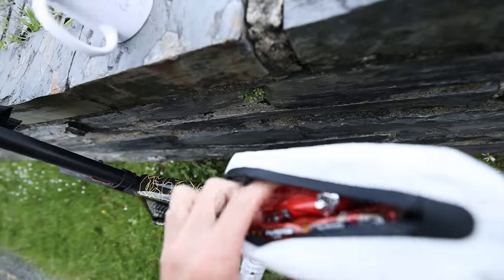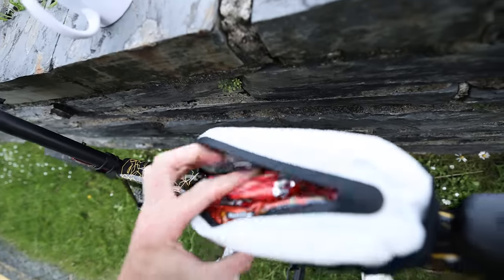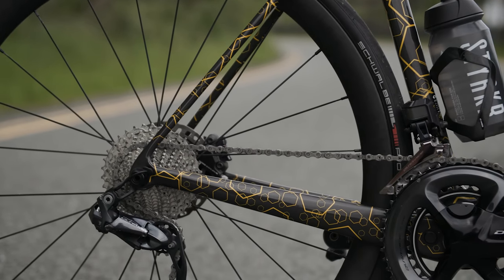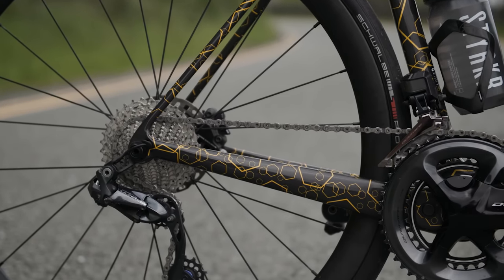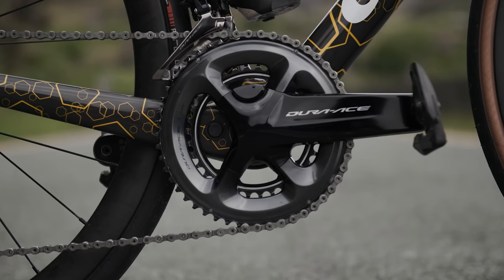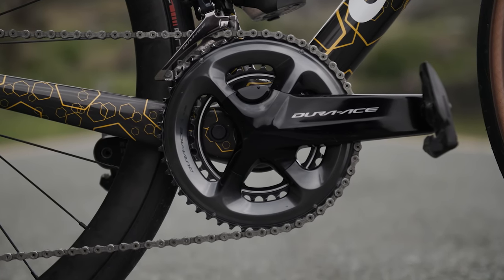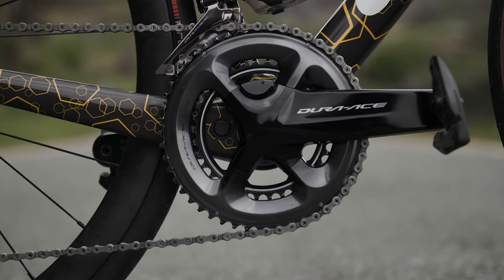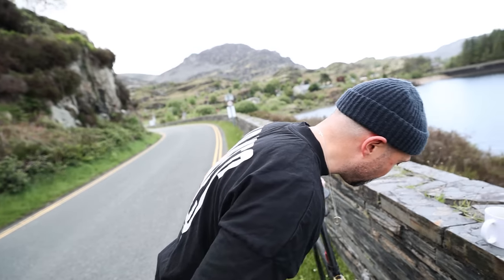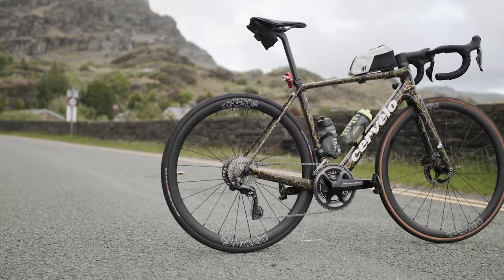He's got food in there - should we eat all of his food so when he's out on the climb later he just won't have any? Groupset is 11-speed Dura-Ace, though not the latest version. It's also got a bit of a mix - there's an Ultegra rear mech, the rest is Dura-Ace. It's Di2, disc brake. The chainset is a compact so 34/50, with an 11-34 on the back - like a one-to-one ratio, good for climbing. 170 millimeter cranks and a Stages power meter on both sides. Dura-Ace pedals.